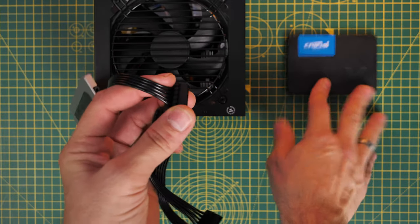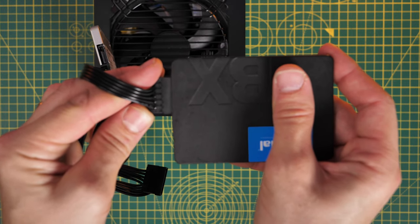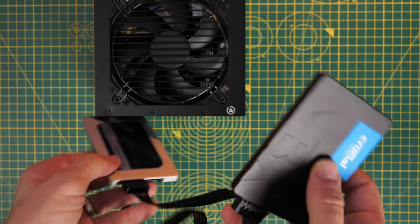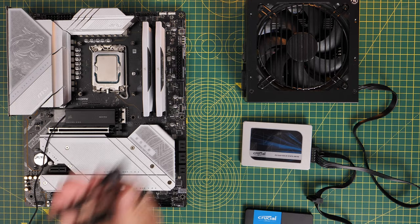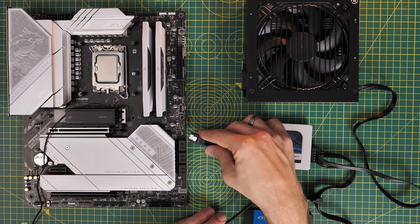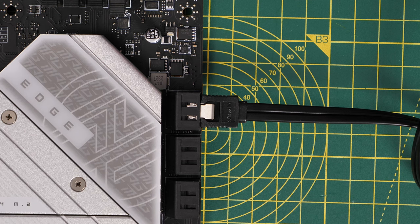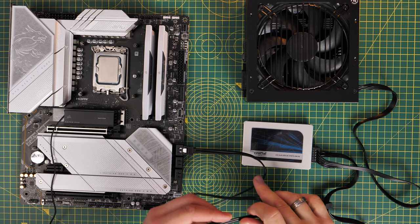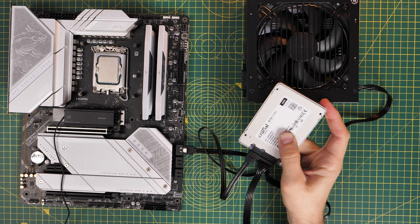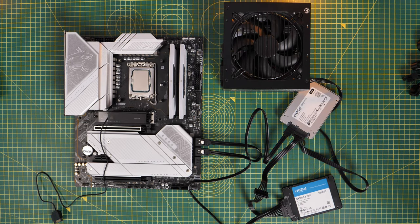You can use one SATA cable for drives and another separately for the RGB controller. Data cables, included with your motherboard, connect the drive on one end and plug into the right side of the motherboard — that ensures you can access those drives. This wiring is shown outside the case for clarity; you wouldn't do it until everything is fully installed.